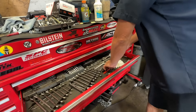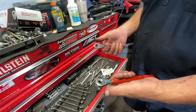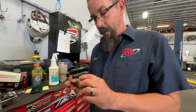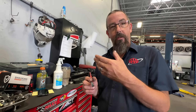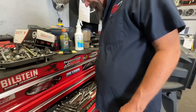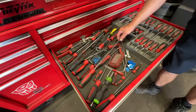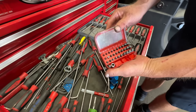Two different-size Chevy battery wrenches for the side-post batteries — reversible, always nice. I've also used these by putting a regular Allen bit in them for BMW and Mercedes-Benz rear calipers where you can't get in with a socket. You can fit the bit in there, put this on it, and still get the caliper bracket bolt. Now we're in the screwdriver and hose-pick drawer — all my hose picks, all my screwdrivers, some more bits, Allen and Torx ball-end sockets.